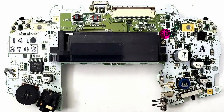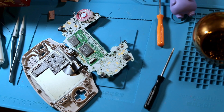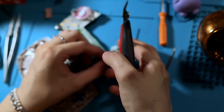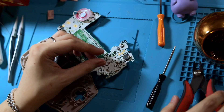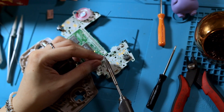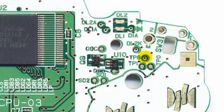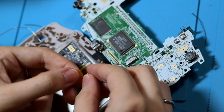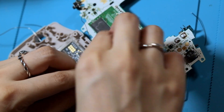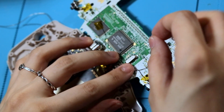Just a side note: if you are using a 40-pin motherboard, Funny Playing does recommend removing the C54 capacitor. I then like to trim the wires so you don't have a bunch of wires just loose in there — trim them as taut as you can while still having some room for error. The solder points on your motherboard are Q1B, TP2, and TP8. Once everything is soldered, I like to secure the points with some Kapton tape — it's also helpful to use Kapton tape to secure the wires along the way so they don't get snagged on anything.